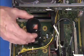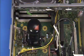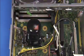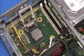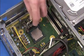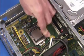Align the removal replacement tool again to pin 1 on the motherboard CPU socket. Press the plunger on the removal replacement tool to release the CPU into the socket. Swing the load plate down. Lock the load lever under its retaining tab to secure the microprocessor into place.